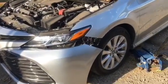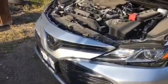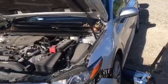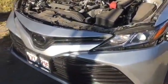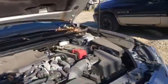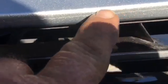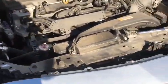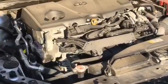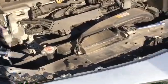For nearly $80 for a half a pint, it better be. Because these custom metallics, I mean, this really is a custom color, if you think about it. They're tricky to match. Got one area where I kind of hung a curtain right here. See that right there? I don't think anybody will notice that though. This is a tiny one, so it could be wet sanded out because the curtain was hung with clear and not the metal flake, but not gonna bother.